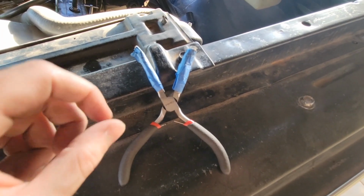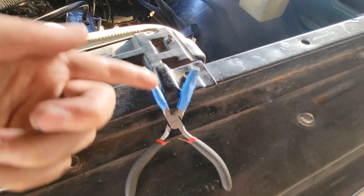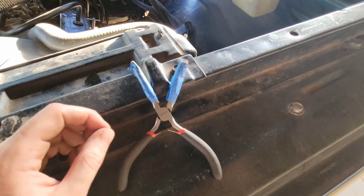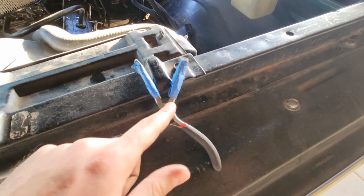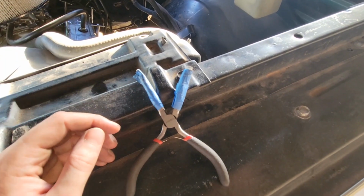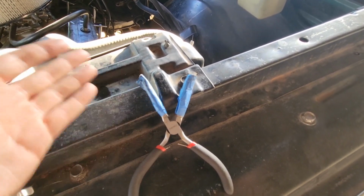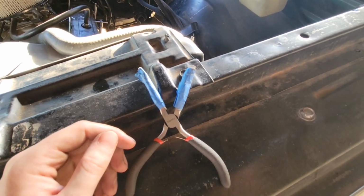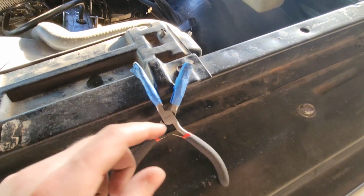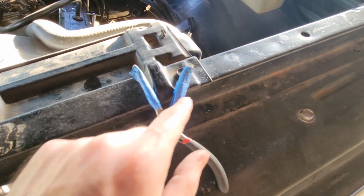As far as getting a grip on the rod, sometimes there'll be enough of a groove to push against it with a finger and lift it up, but sometimes it's a little tight in there. I don't really love using needle nose pliers because I don't like the metal on metal. I don't want to create any notches in it that will eventually affect its performance or add metal to the engine. So if I have to use a tool because I can't get a good grip, I do duct tape first for the first layer, and then masking tape around.